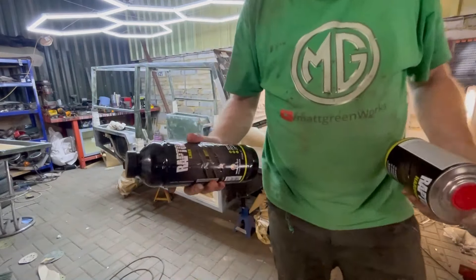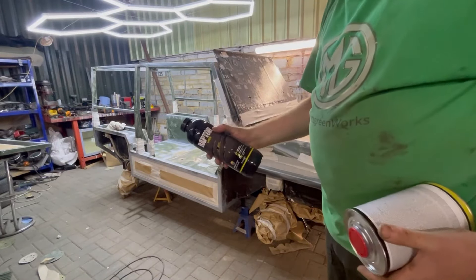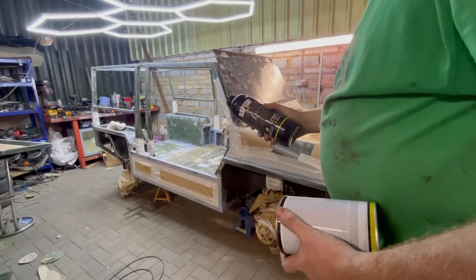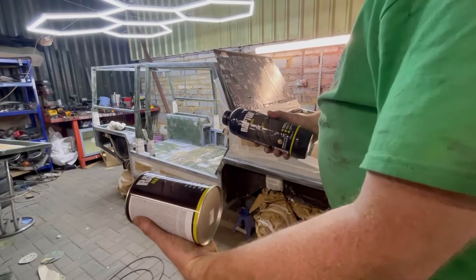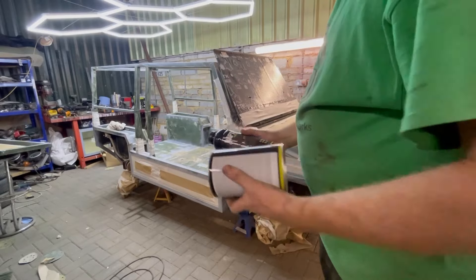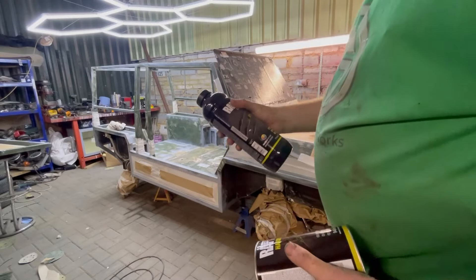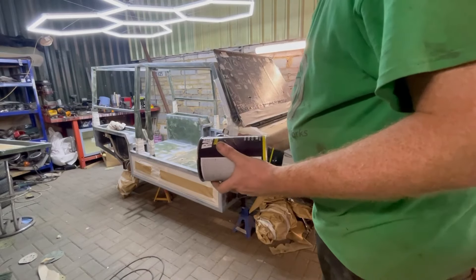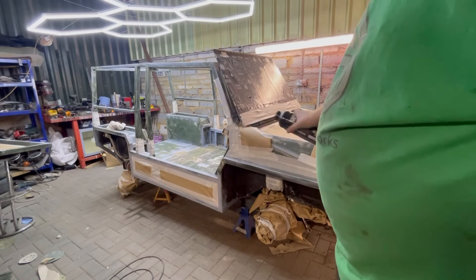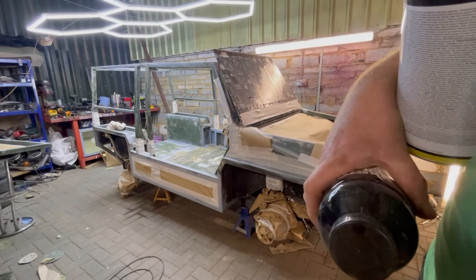So this is the Raptor liner. We've got four or eight of these but hopefully I don't need four. Always make sure you have a few more because it's really gutting when you run out - when I did the pickup once I ran out and had to go grab one from Pete. You add a mix of hardener with it. It's tintable, so you put a certain amount of your top coat colour in there - read the instructions, don't do what I do. Put some hardener in and the top coat, give it a good shake and blast it on at 60-70 psi with the proper gun that comes with it. Give it a try first in an area you don't care about, like under the wheel arches.